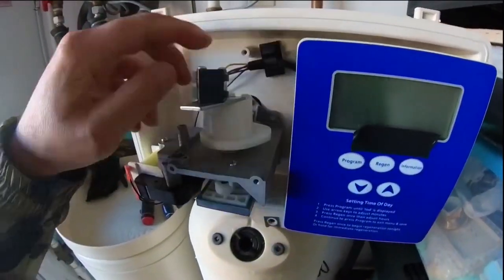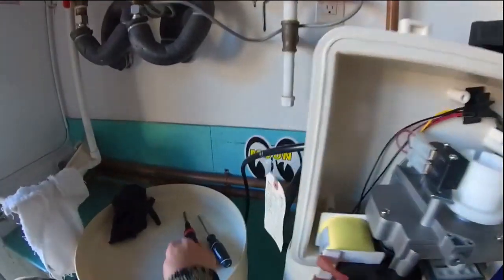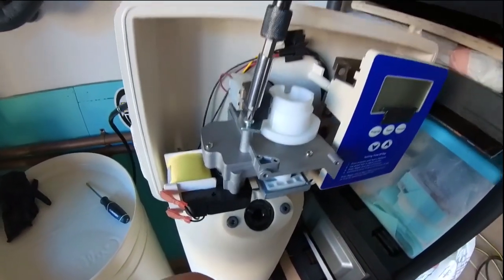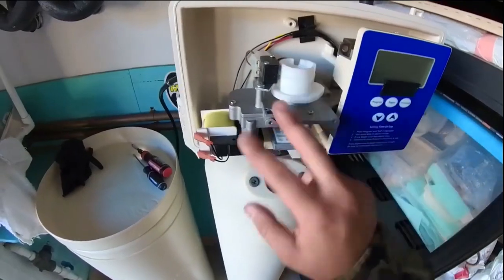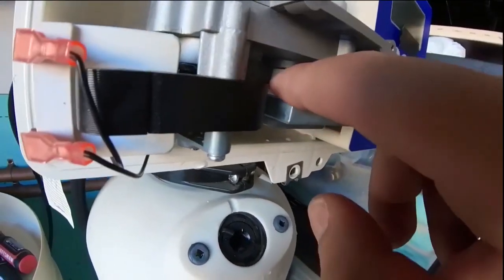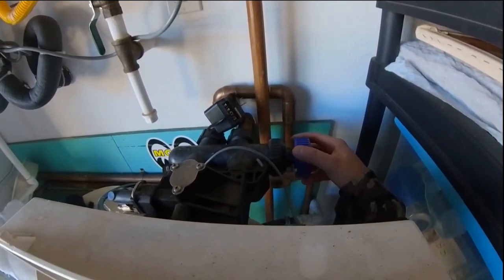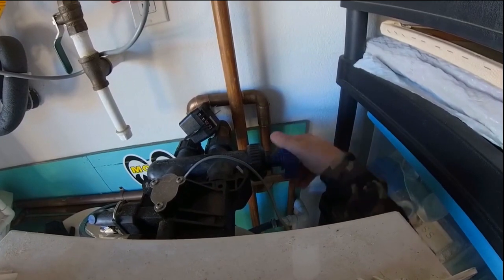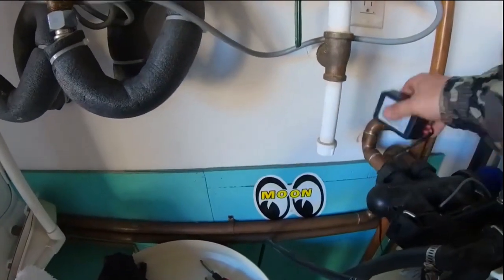Next, take your micro switches and make sure these little gray switches are touching the cam — that's the only way it goes. Grab the screw and screw it back in. Everything is put back together. Make sure everything is in the right place — make sure the piston is there on the white plate. Go ahead and take it off bypass by turning the knob. When it's fully open, you will feel it lose resistance — when there's no more resistance, the bypass is fully open. Go back and plug it in.